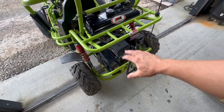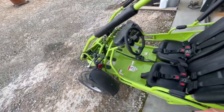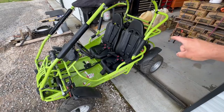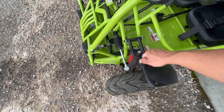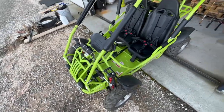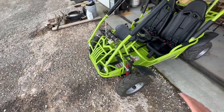Things like the motor to the frame, the little guards, shock bolts, and steering components all came pre-assembled, but go back and check anyway — there were a couple of bolts on the motor mounts that were loose. The steering components have cotter pins in them; just pop them out and tighten. You don't want to get it ridiculously tight, but there should be no wiggle room. The lights came pre-assembled and were also loose, and one of the horns was loose too. Just check everything, including the electrical — some of that was loose as well.